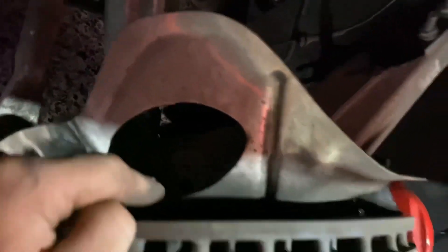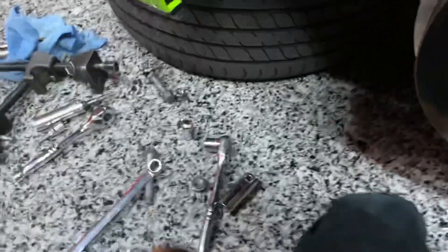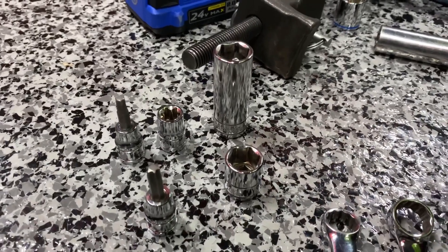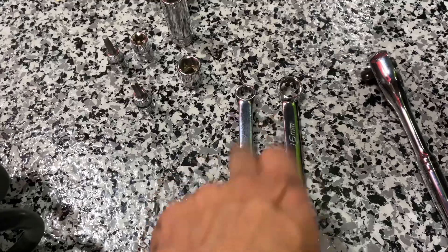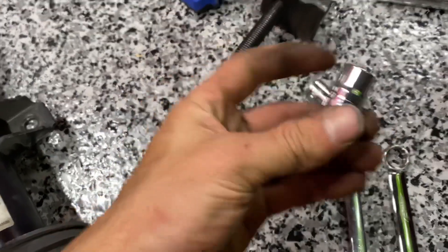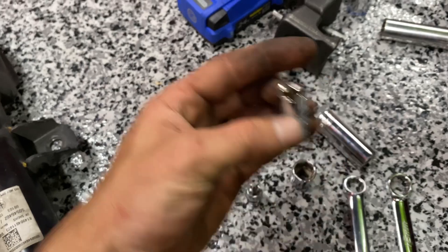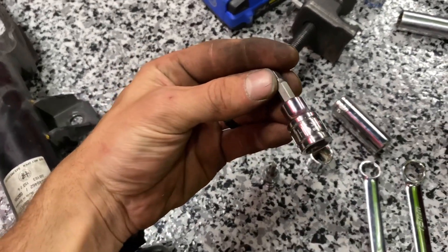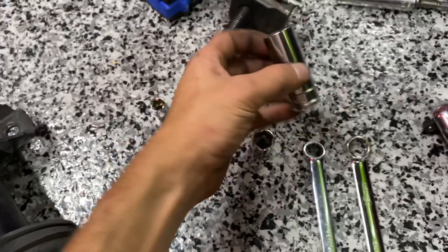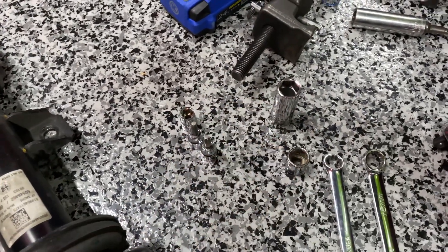This is the pad sensor — it's connected to the caliper, back side. And then through this little hole there is the ABS sensor, which we also disconnected. These are what you're going to need to take off the front: a 14 wrench for the E socket on the bottom, this is the 16 millimeter, and then an E socket — E14 — for the top. An Allen which is an H5. Torx T40. 17 millimeter. 16 millimeter. And that's it.